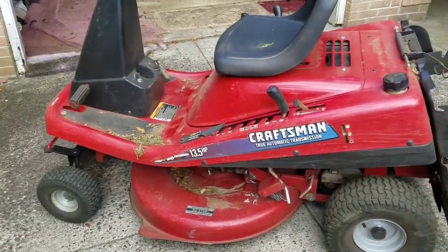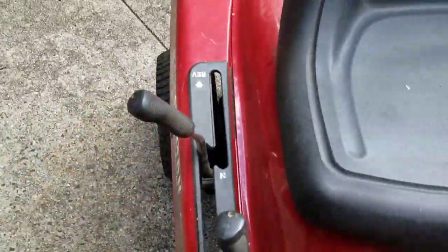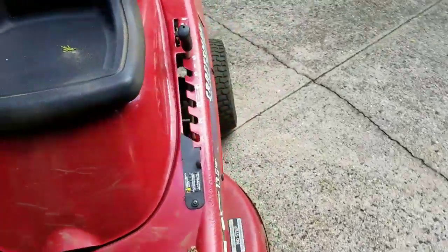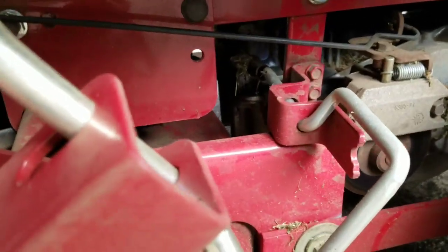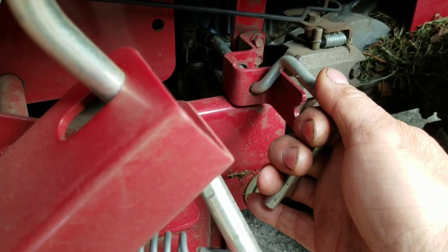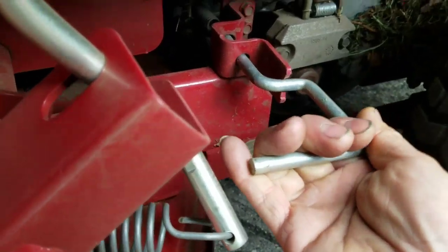What else here? Oh, so look. That's in neutral, right? Out of gear. It's a hydrostatic transmission. So you can't push or pull it without the engine being on, unless you disengage the transmission. So here, this lever here, it's in, okay? If you wanna move and push this around to freewheel, you disengage the transmission by pulling this and hooking it there, okay? Now,